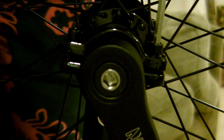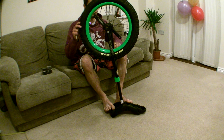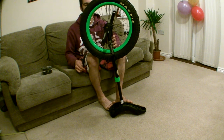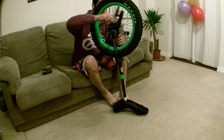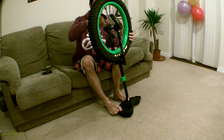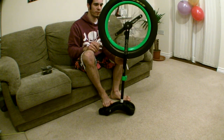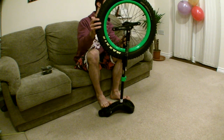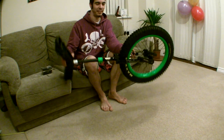How do you know when you've done these bolts up tight enough? Give the wheel a spin and see how long it will spin for — that is a very good gauge of whether your bearings are too tight or not. As you can see, it comes to a stop fairly quickly, so I'm just going to slacken off those bolts. You don't need to do this much — maybe a quarter of a turn. Then flip it round and do the same to the other side. Now give it a spin again. As you can see, that spins for a lot longer. Those bearings are about perfect. If you ride with bearing holders that are too tight, you can damage the bearings, so you need to get this step right.